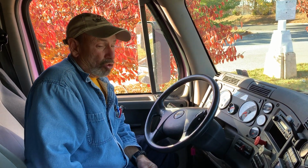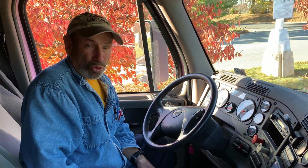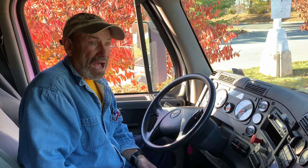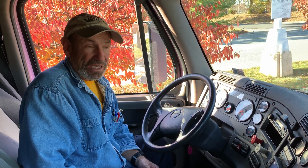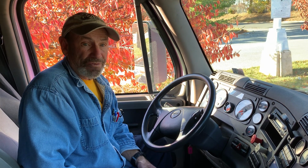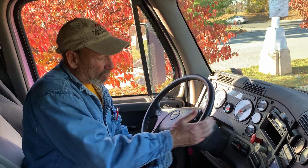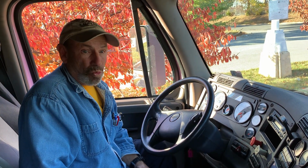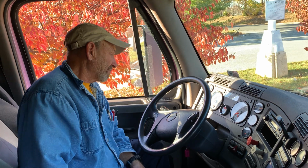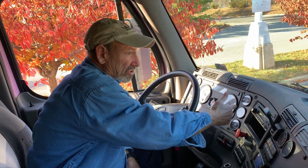The normal time to do a whole complete pre-trip on the front, the complete tractor, it's usually 25 minutes for those students who know how to do it. About 25 to 30, no more than 30 minutes. If you studied and you know how to do it, that's your time frame, 25, 30 minutes. But like I said, going back, air brake leak test is one test that will fail you right away. So you're going to make sure that you have at least 100 psi in both gauges.